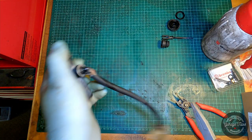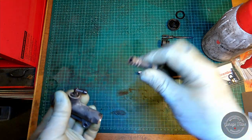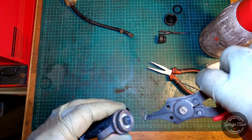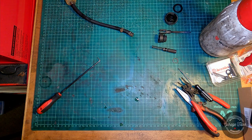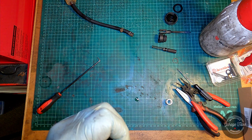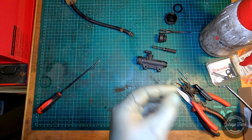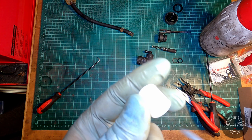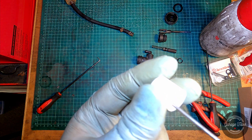We've got the sound back, isn't that great? So the piston actually looks very clean — there's none of the corrosion or debris I was expecting. I don't know if you can see that, but there's a pretty big scratch there — that's my fault, I did that while trying to pull it out; I wasn't particularly careful since I'm going to replace this anyway. But apart from that, there are no obvious signs of trouble.